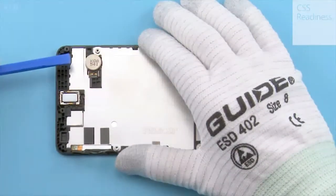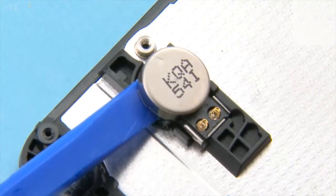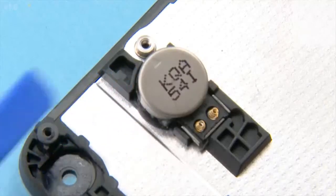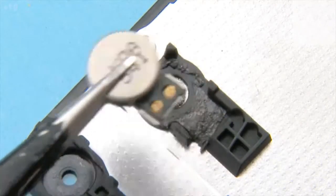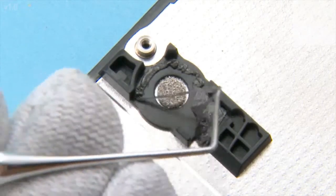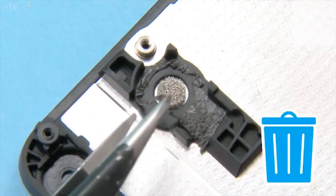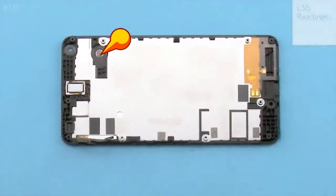Release the vibra with the SS93. Use tweezers to remove it. Use the dental tool to release the vibra adhesive and peel it off with tweezers. Do not use it again. The shown vibra grounding foam is not a spare part — do not remove it.